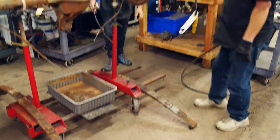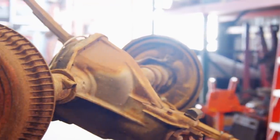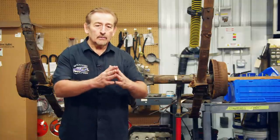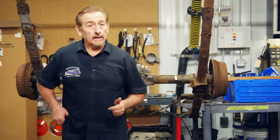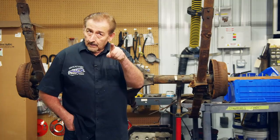There's an anomaly on this one that even Tony doesn't have the answer to. Of all the Dana 60s, hundreds of rear ends over the years — we've never seen one featuring 11-inch brakes on a 4.10 Dana axle. The number 026 is the last three digits of the assembly number. When you look 026 up — which is also on his broadcast sheet — it says you get 10-inch drums. According to the parts book, according to Chrysler, if you got a 4.10 gear ratio Dana 60 in an E-body in 1970 and 71, you mandatory got disc brakes in the front and 10-inch rear drums. But Wendell's Phoenix Cuda has 11-inch drums on it.